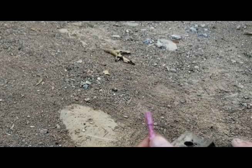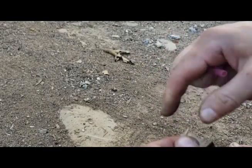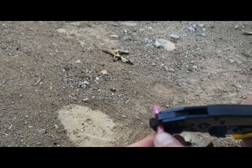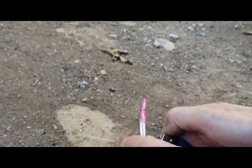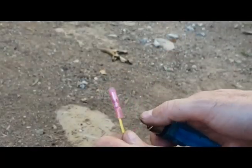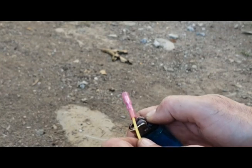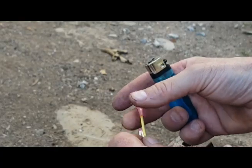On this one I probably could have used a larger bullet connection, but the other end would just be falling off. It looks like it went through pretty well. These connectors are really cool — they cost a little bit more but they're definitely worth it. I like using a lighter because it's easier — something most people have lying around. Watch — it shrinks right up. The shrink tubing works just like regular heat shrink, and it suctions right around the connector. Once it cools down it'll be pretty stiff.